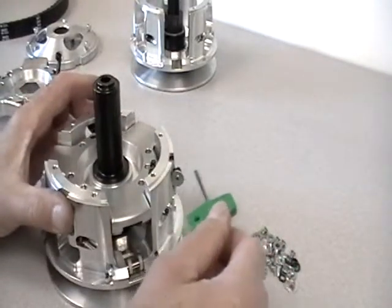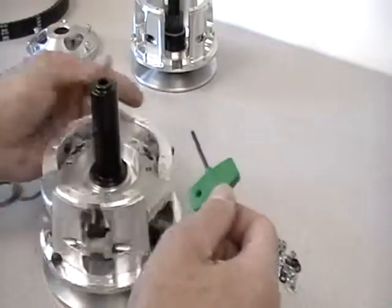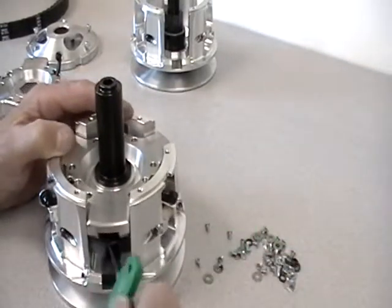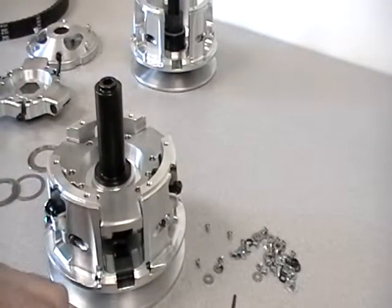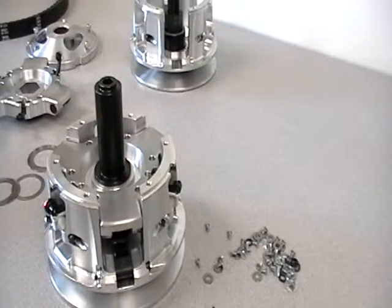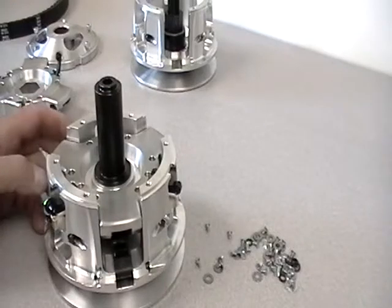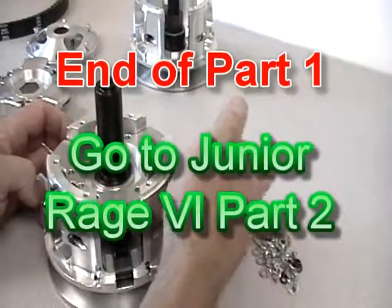Just keep in mind that every arm has to weigh the same. If you put one washer on one arm, you need to put one washer on the other two arms as well, or your clutch will go out of balance. That holds true for the second stage arms as well — all arms need to weigh exactly the same. I would suggest purchasing a gram scale. We sell them here at Supreme Tool for $15 and we calibrate them as well. It's a must-have — important to keep your cam arms all the same weight as close as possible.